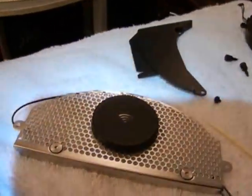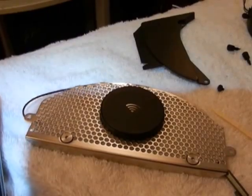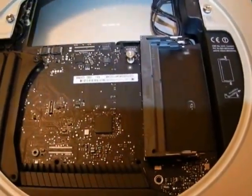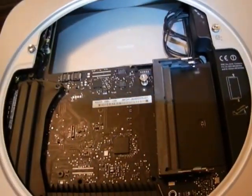Three for the fan, one for the cowling, and two for the Wi-Fi grate. This is the best — other than a memory upgrade — the cheapest way to upgrade your base model Mini. All Toshiba 2.5-inch hard drives are made by Hitachi, so ignore the Toshiba name.